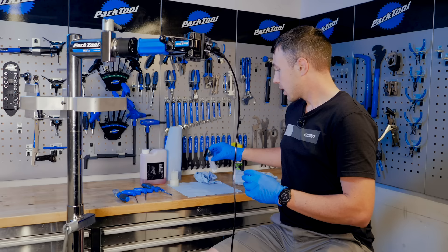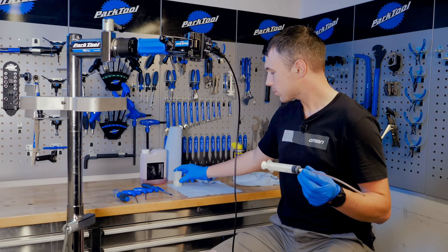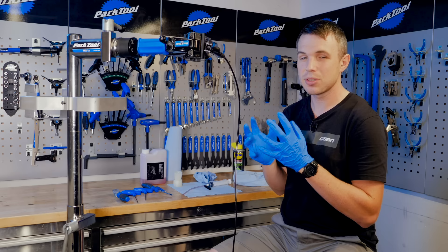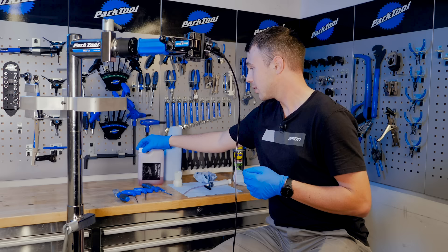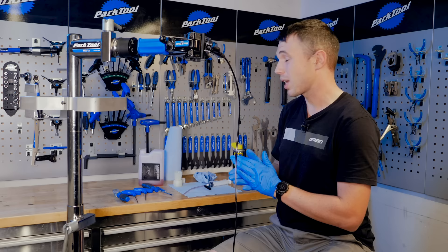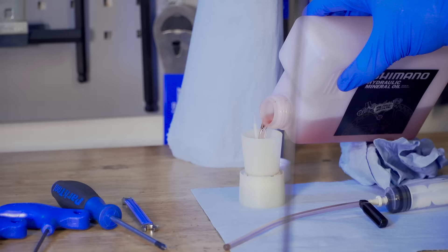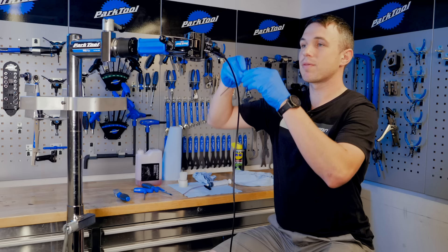Before you put a bleed kit away it should be clean — same with these syringes. If you take them out and they're not clean, let's just do a proper job. No excuses not to have clean tools. I'll always wipe down the outside of the bottle to reduce the chance of contamination. We're going to start by going straight from the bottle and putting just a little drip of mineral oil in the bleed bucket — it doesn't need to be much. That isn't where the oil gets introduced to the system, but there's a very good reason as I'll demonstrate in a bit.